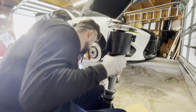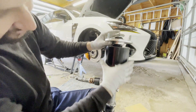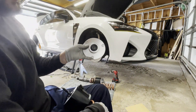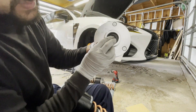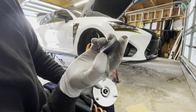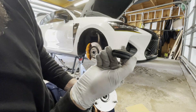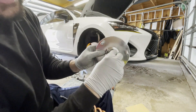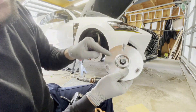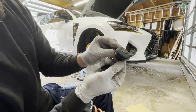So you can see this bushing — it sits like this: you have the washer on top, the bushing in the middle, and another bushing underneath. This top bushing — look at that, tore apart. The fail point is this slit it has in the middle. The rubber piece from the back end came through. Look at that — completely destroyed.